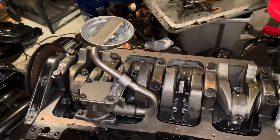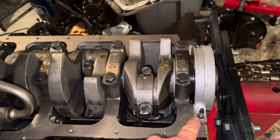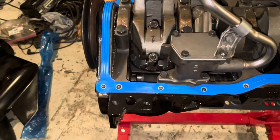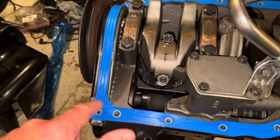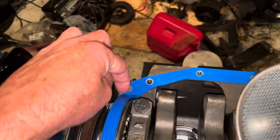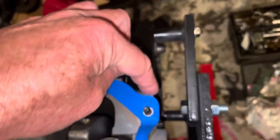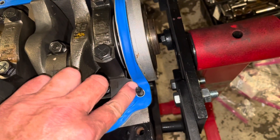The oil pump is now installed. Now I'm going to put the oil pan gasket on and apply silicone sealant in certain places. I've laid the oil pan gasket out on the motor and I'm figuring out where to put sealant. I'm going to put gray silicone sealant in the corners underneath the gasket — in this corner and on top — and smear a thin layer all the way across here underneath the gasket. Same thing on the other side: into the corner and out to about right there. In the back I'll put silicone just in the corner underneath this gasket and all the way over to where the rear seal met the block.